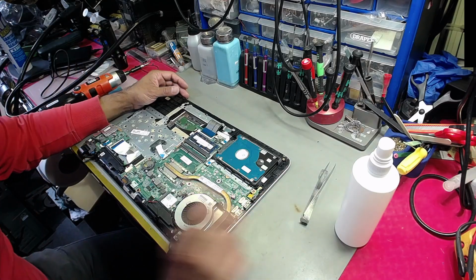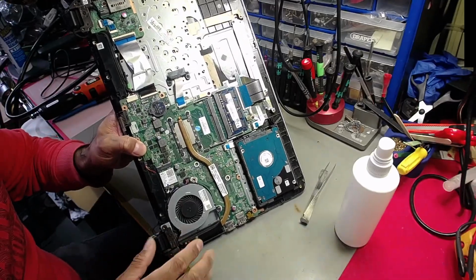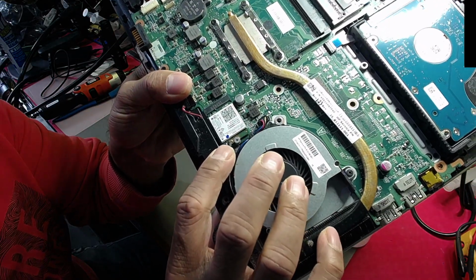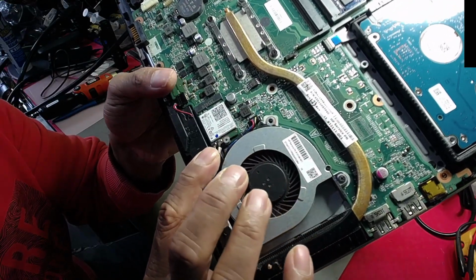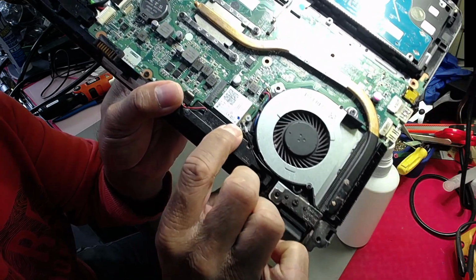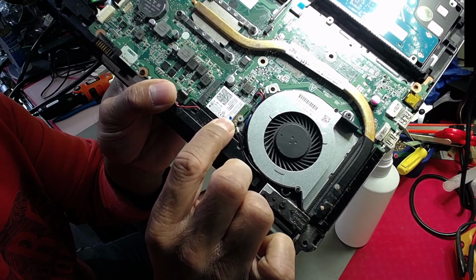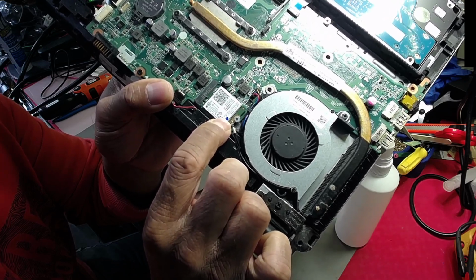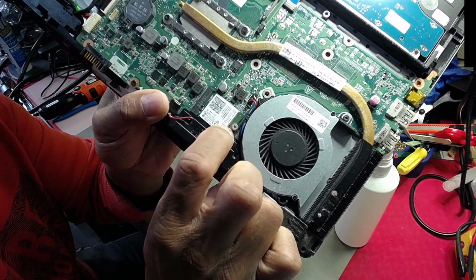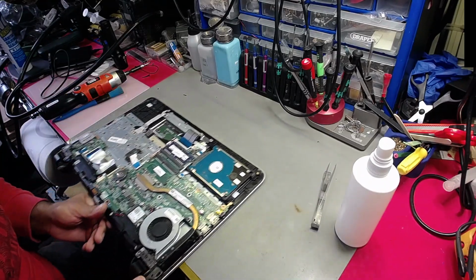Yeah, this has been opened. This has been opened by somebody, I'll tell you that. My instinct says, look, right? So when I open up a laptop, which I did, this had a board repair back in the days, quite a while ago. See these two antennas? That one's got a blue marking on. That has no marking. Where you see that marking, that's my dot. That's a signature of me working on that board, right? This antenna should have been on that side, and that antenna should have been on this side. So that tells me that this has been to a workshop somewhere else.